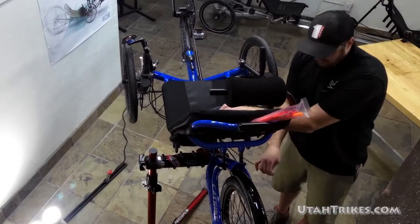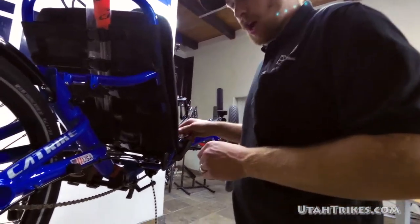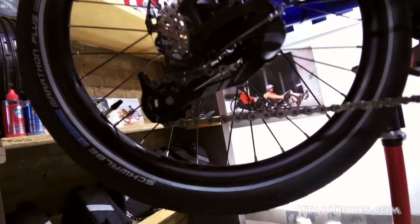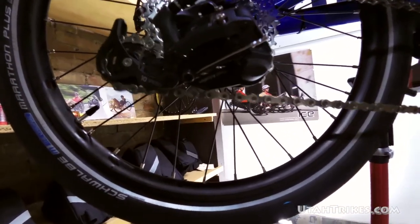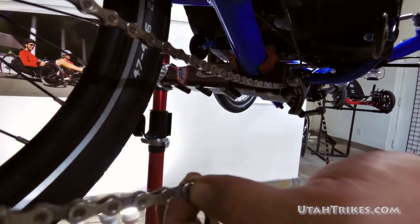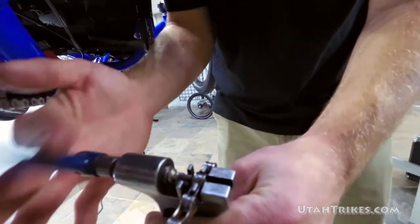The chain is too long right now, so we're going to cut a couple links out. I've got a Park CT3 chain tool — this is the big one we use here at the shop, but there are all sorts of different chain cutters that work well. What you want to do is replicate the clearance between the derailleur and the chain that we saw before. Measure that up here with the two ends of the chain. I'm matching up the two ends to see where I need to cut. It looks like this link right here will do it. I'll get my chain tool, rest it in there, and press the pin out.